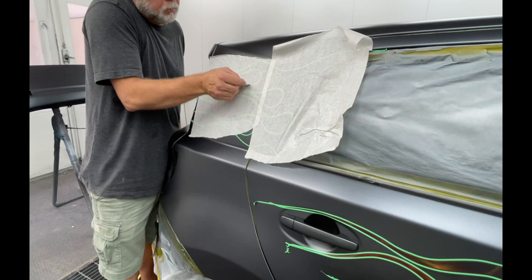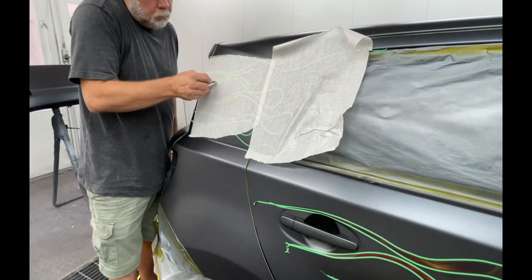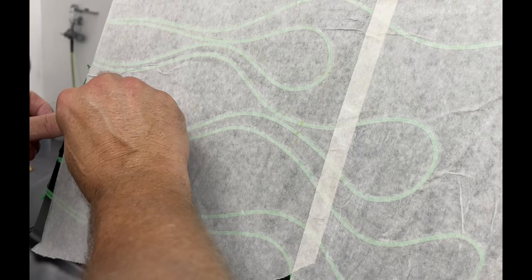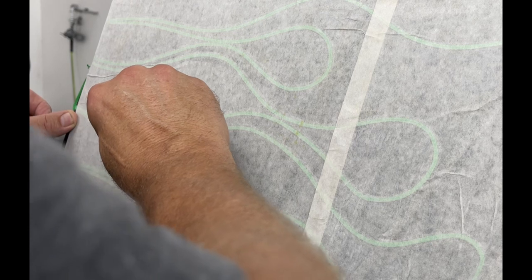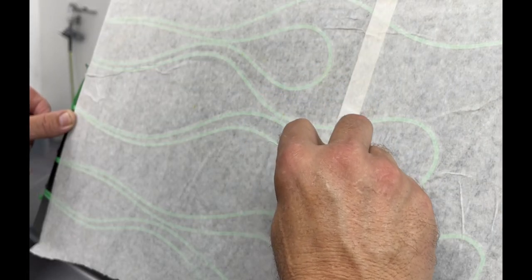You have to just gently cut the white mask off only without going through the fine line. So you have to practice that a little bit. It's really easy to cut too far and cut into the paint, but using a thicker fine line helps avoid that.